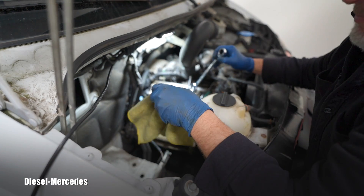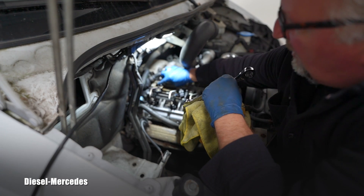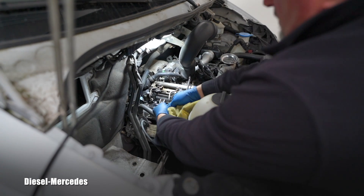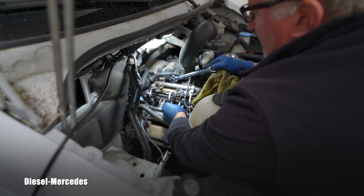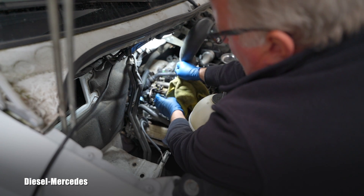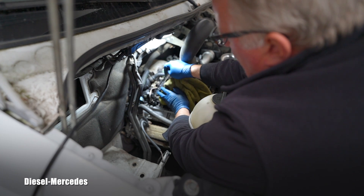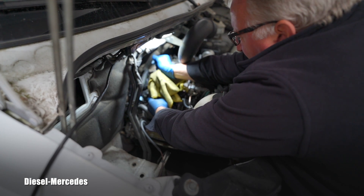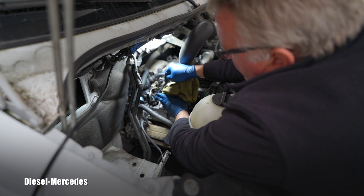The pressure is 100 percent gone - I have this loose by hand now. I need to crack open this other one - it's 17mm up here. Be careful of the return line nipple, so it's not easy to maneuver the wrench here. Always be careful so you don't break anything. There's no more pressure in it so I don't need the rag there.